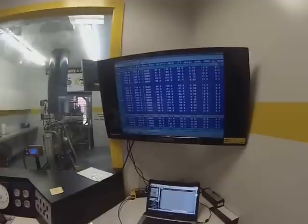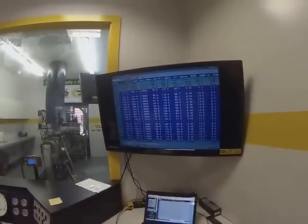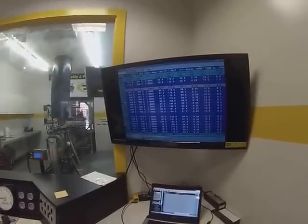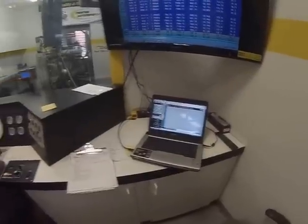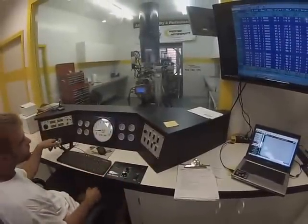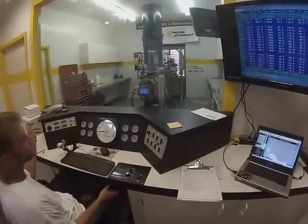Not too bad, 451 horsepower at 6,100, and supposed to get 430 foot-pounds at 4,600. Pretty strong considering that's a 425 horsepower camshaft combination for us, so it runs pretty well. If you just want an idea, sitting here at 900 RPM idle, we've got a pretty good air-fuel ratio, about 14.8. And it's just responsive. And in the car, I'd imagine it'd be just bad to the bone.